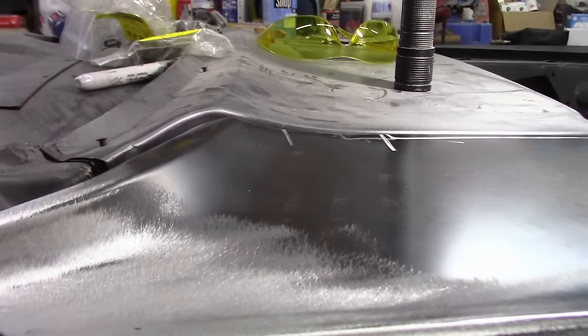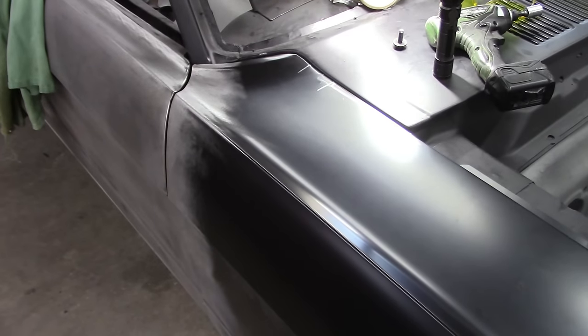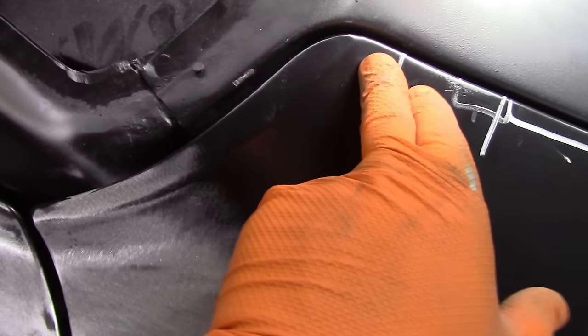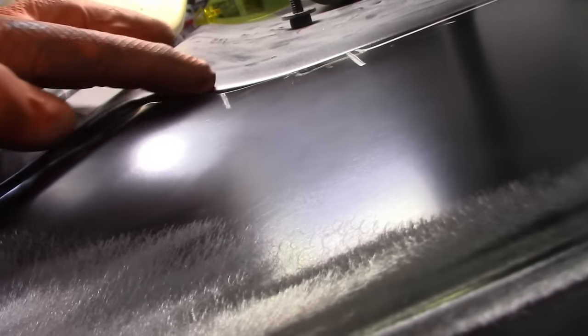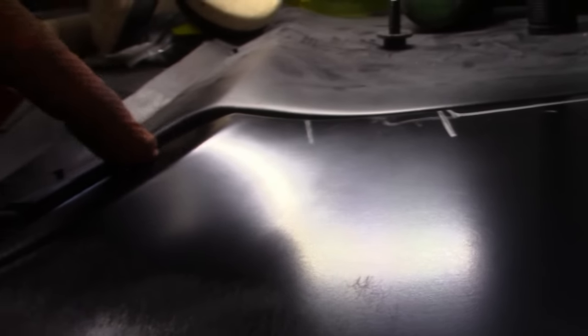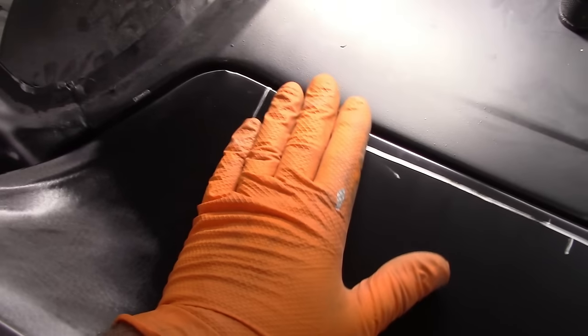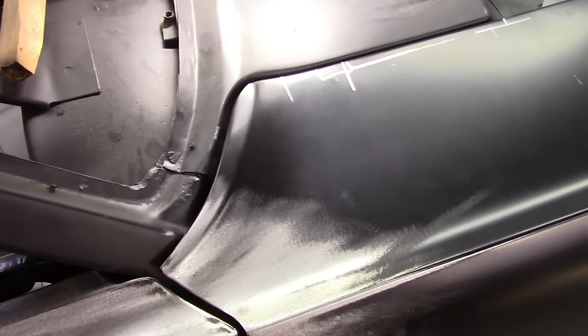This is where I was talking about this transition right here. It's close but a little bit off here where it meets the top part of the cowl. I want to try to adjust this and clean up that edge as best I can. Some things you just have to live with - you can't fix every single little thing. But while I'm at this point I'm going to try to fix the little things so it's not an issue later. I'm happy with that because now nothing is chafing, nothing is making contact on that cowl, and the transition is much better. I cut loose the other spot welds and that allowed this to move and fit much better. Now I'm going to go back and weld those in place.